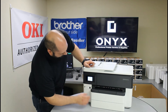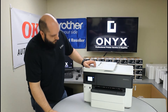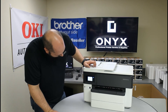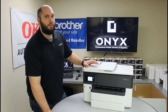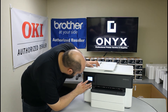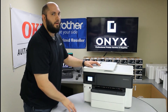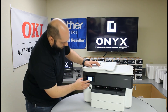Now the printer is going to ask you to install or add paper. If you have some available, it's just fine — if not, you can proceed a little further without it. We're going to follow the on-screen instructions. Sometimes with ink machines it takes a second to get going — it's got to pull all the ink through the machine and get set up and ready. It's going to ask if you want to do your alignment. Because I don't have paper in it right now, we can follow that step later. It's also going to ask if you want to connect to the internet — right now I'm not worried about that, so we're just going to skip that and hit Connect Later.